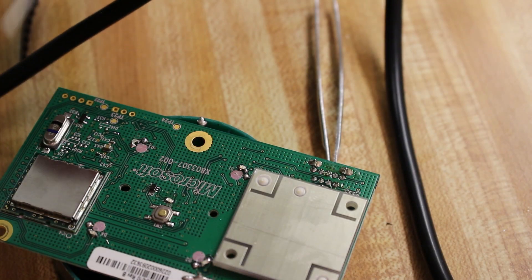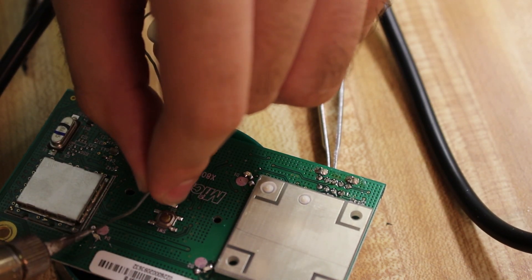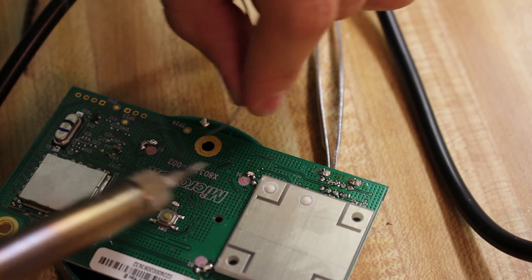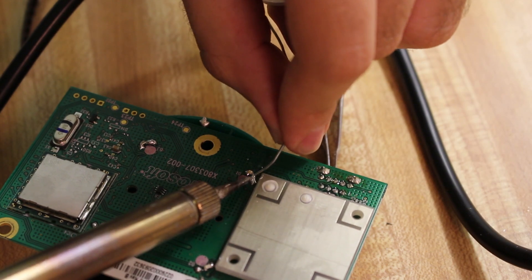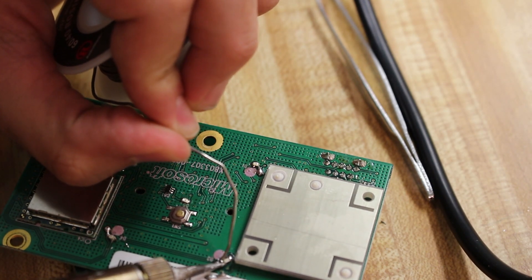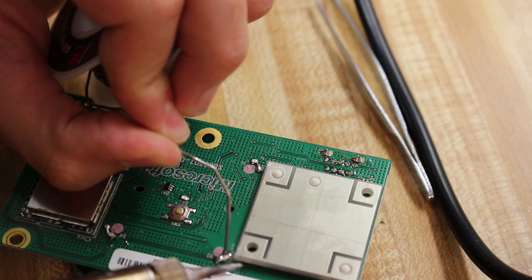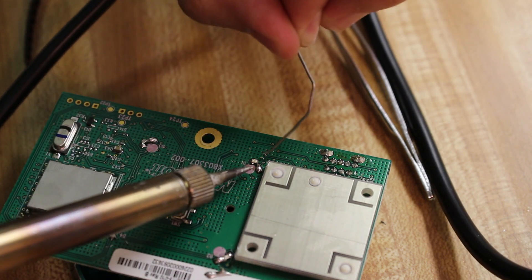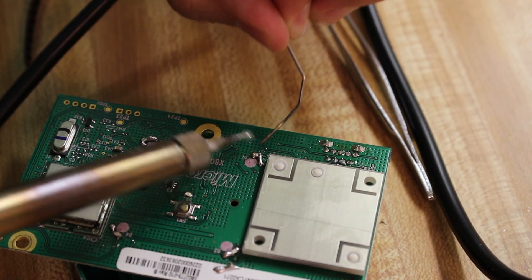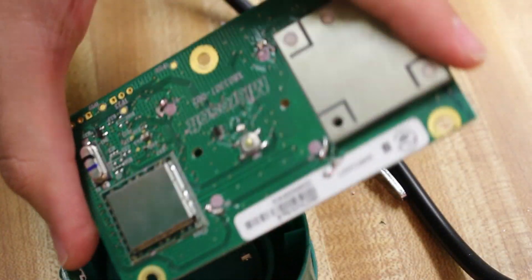Now you have all your LEDs installed. There's one little thing I want to share with you that I don't see many people talk about. If you boot up your Xbox and it's supposed to be showing the green lights, your lights will show up fine, but what if your system ever gets a red light issue? If that happens, your lights will not show anything and you cannot diagnose the problem. What you can do to fix that is go in on each quadrant and solder both of the negative pads together, which is what I'm doing right here. That way, if your system ever needs to display any type of red light, it will display them just fine. Just solder those two negative pads on each one together and you'll be good to go.